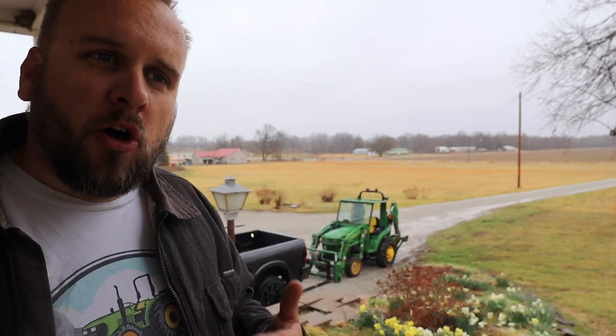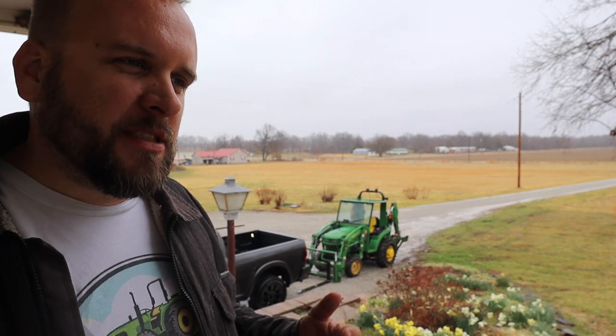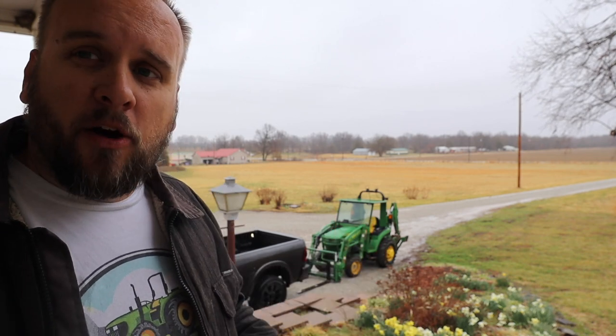Hey, it's Brock here with Rock Hill Farms. Any of you guys that have been following along know I've had an issue with my tractor just randomly dying, although it's not that random because it seems to be when it's been running a while and I'm not in the seat and I'm operating the backhoe. Whenever the backhoe moves the tractor and it shifts, it will kill the tractor. I think it's been a matter of the neutral safety switch losing connection.